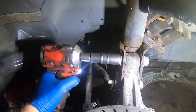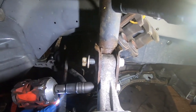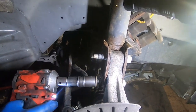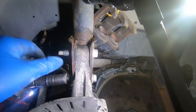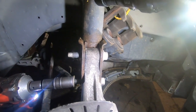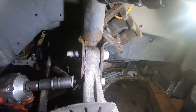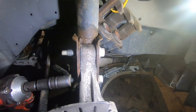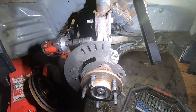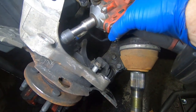21 millimeter here — just going to take these bolts and nuts out. You'll probably need to tap on these bolts to get them out. Put your nut back on a little bit and give a couple of light taps, or use a drift — don't beat them hard and mess them up. Then we pull this whole thing back. You push in on the axle while you do that, and then look at the wheel bearing. Inside there are three 13 millimeter bolts — already got two loose, going for the last one.